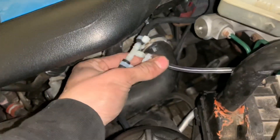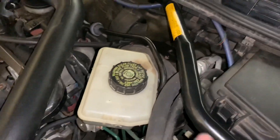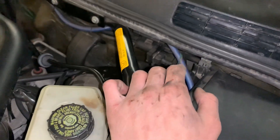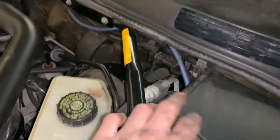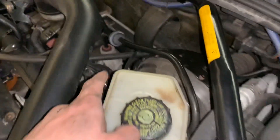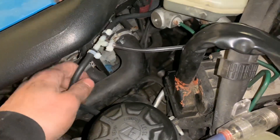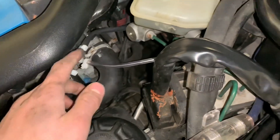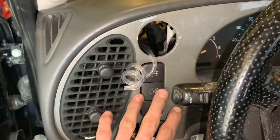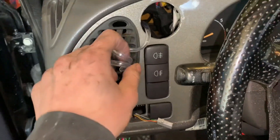I rerouted the vacuum line — it comes up through there and you have to reach your hand in the hole and pull it out. For my car I have the solenoid delete — I'll put the link in the description below, it's really easy to do. If you have a tuned stage 2 car you should always do that as it reads boost so much better. I only have one vacuum line going to my bypass valve, which usually reads manifold pressure, so I'm going to tie into that one. Basically everything under the engine bay is done — button it up and keep the vacuum line secured so it doesn't fall.